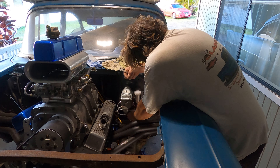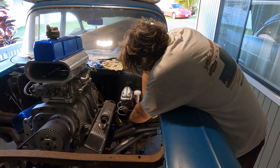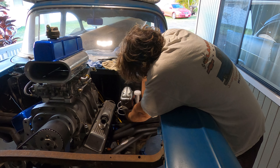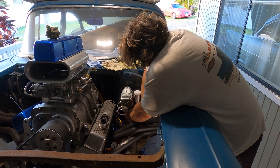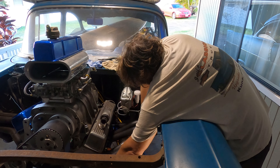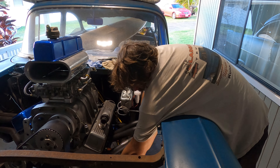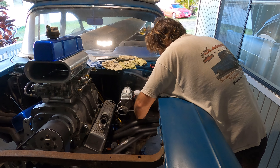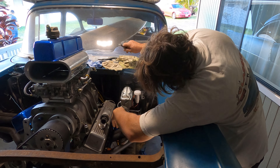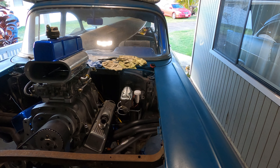Okay, let's see if I can get this nut in - will this nut feed in this hole? Let's bend this line where I want it, where I had it in the first place. So it's not 3/16ths or 7/16ths - it must be smaller, which is 3/8ths. Let's see if I have that line wrench.